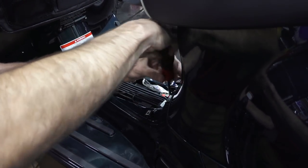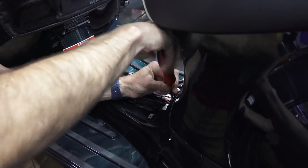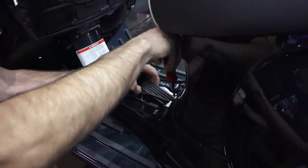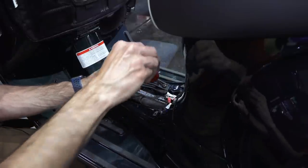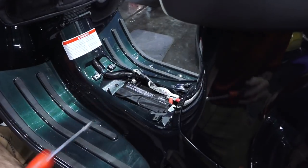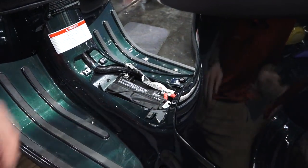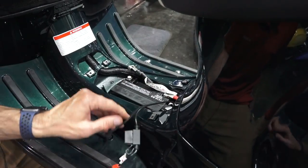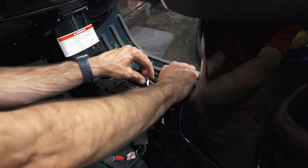The T30 is two sizes larger on the Torx fastener scale. Pull this battery strap — you can even leave the screws in there. That is your main fuse. FYI, if you ever accidentally reverse the battery terminals or do something like jumpstart in reverse, it will blow the fuse located in there. A lot of people look at the fuse panel in the glove box when the scooter won't start — that's your main 30 amp fuse.